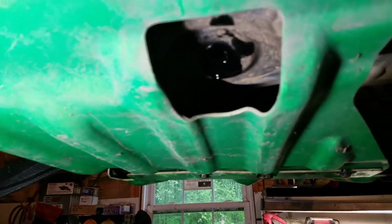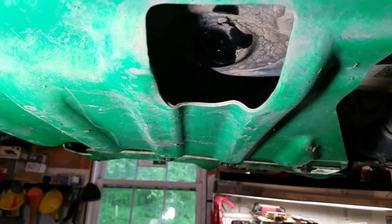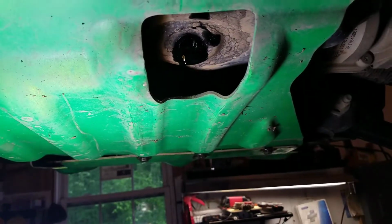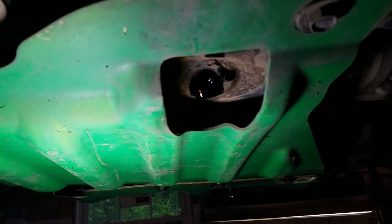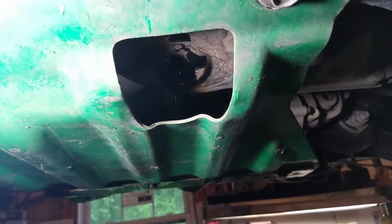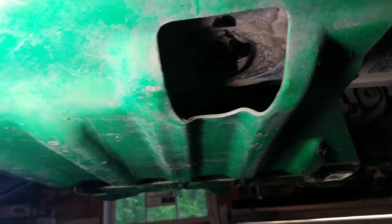would be conditioning your skid plates if you use your truck off-road. It's always a good idea to see if any damage has been done, how close you've ever come to the oil pan. When I had this up to Roush Creek one time, I smashed the skid plate up against the oil pan and actually put a scuff mark on the drain plug. So that's one thing you want to make sure you watch, because these aluminum skid plates aren't very strong.